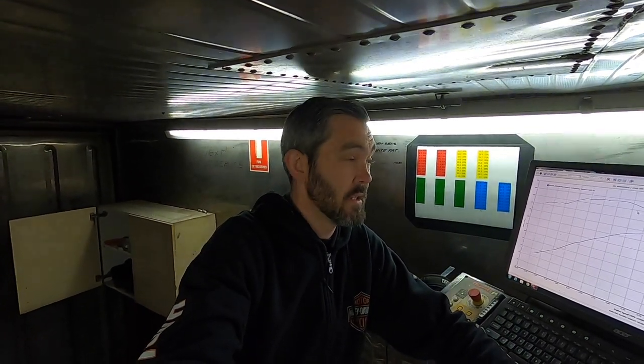And again, some of you out there might be saying, oh, my numbers are a bit low. I'm 2,200 feet above sea level, so I've got less air pressure up here. If you take this exact tune down the road, you'd probably pick up 6 to 8 horsepower as well. I've seen it happen on my lowrider. It went 158 in Gladstone, I brought it back here, it went 150. So 8 horsepower just out of the same tune, just up in elevation.